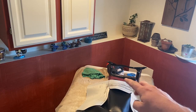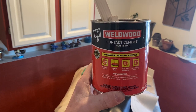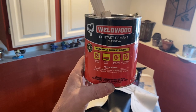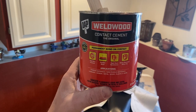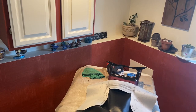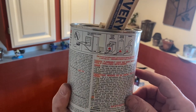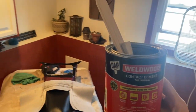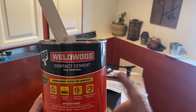I got my marks lined out for where I'm going to put glue, and I'm going to lock this section in first. I'm using Weld Wood contact cement. They also make an HHR which is a high heat resistance version, but I looked at the tech sheets and this regular one actually has heat resilience up to 180 degrees and the HHR was only up to 150, so I'm just going to use this. You can buy it at your local hardware store. Make sure you have plenty of ventilation because this stuff really stinks — the warning label mentions shutting off flame sources because the vapors could be a problem. You coat both sides of the material and then let it set until it's tacky before it'll work.